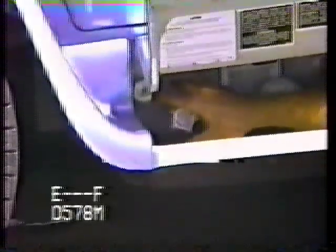Down here is your propane system, giving you access into the propane tank. The newer propane tanks on 1995 or newer are 6 gallons. You have a gauge in the corner that tells you how much propane you have. You can only fill them 80% — don't worry, the guy at the station can only fill it 80% also. Here is the on-off valve. Turning it all the way to the right or following the close arrow will shut propane off to your unit. Turning it to the left toward the open arrow will allow propane to flow so you can work your appliances.